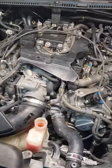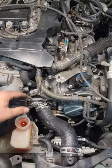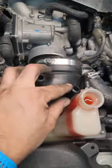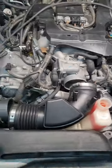Call it foreshadowing, call it being a hoarder. I'm gonna leave the valve cover venting because who wants valve cover oil back in the intake? I'm just gonna cap these two off with three-quarter inch caps to keep the intake clean of any oil vapor.